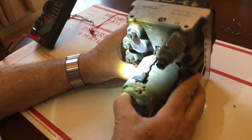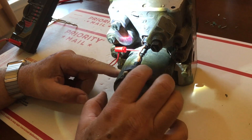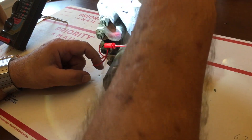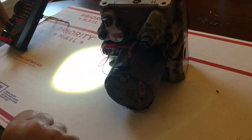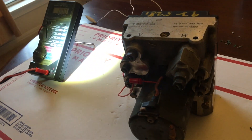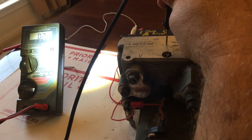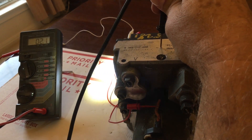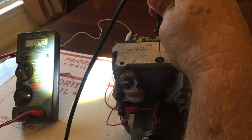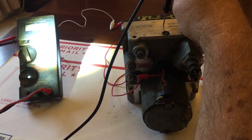I have a little section of this wire that I've exposed so I can put a meter on here. This is the positive wire of this motor, and this is the ground. This wire feeds through here and connects to that wire we were looking at on the inside. So we're actually taking a resistance measurement of that wire to see if it's touching ground. Right now you can see there's no connection, but if I touch the body of this thing, you can see it's 2.1 ohms of resistance. That means the wire is touching inside, and it's probably not low enough resistance to blow a fuse, but it's enough to tell the ABS computer to shut down because it knows it's an unsafe condition.